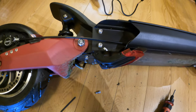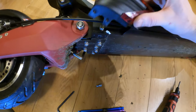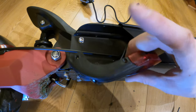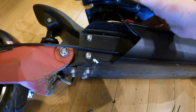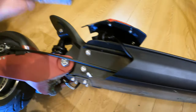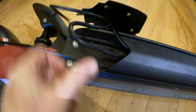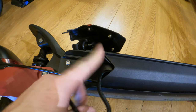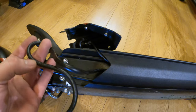This is the back right side. I pulled off the light by unscrewing two screws on the bottom and two screws on the top, then pulled it out. I discovered that the tracker fits inside this little hole perfectly. I can just slide it in here, tap into the wire for the lights, and we'll be all set.